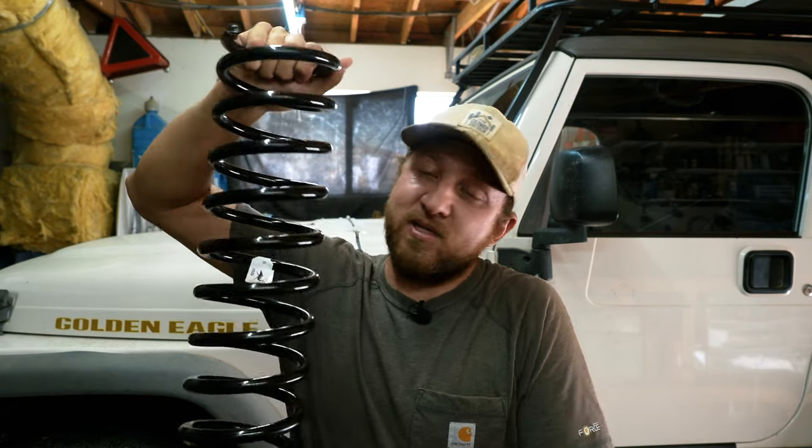All right, with all that out of the way, let's talk about springs real quick. There are a few different versions. You can get linear rate, you can get progressive, you can get dual rate, you can get triple rates, and in the dual rate and triple rate, you can get a combination of progressive or linear. What's linear mean? Well, essentially, linear means, like this spring here, as you push down on it, the rate is constant all the way through.